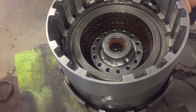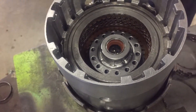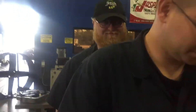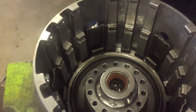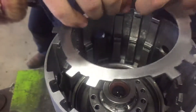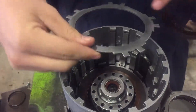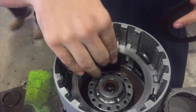How's it going? Phil Bernard here at Jade Tech. Today we're going to go through automatic transmission clutch packs. In this unit there are going to be three sets of clutch packs, and a general rule with these is that a friction disc does not go against a spring plate, and you have to alternate friction and steel throughout all the clutch packs.